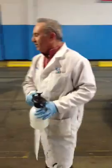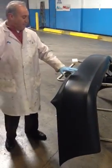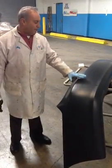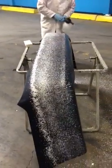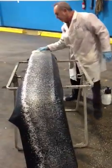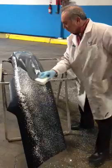We'll come back to this in a minute. Now we're going to come over to this bumper cover that we've got from LKQ Keystone, which is primed with water-based primer, and we will do the same thing by preparing it properly. We'll take the super sponge and wipe the entire bumper cover to make sure the foam pre-cleaner gets exposed to every area.